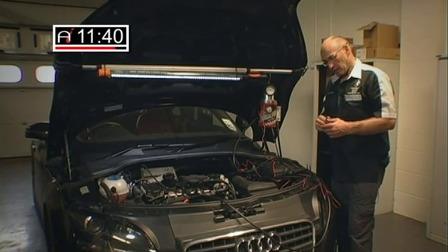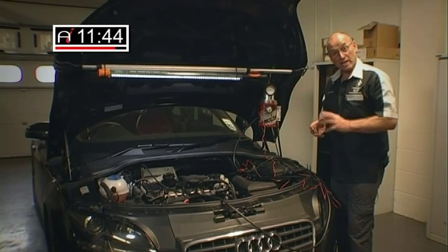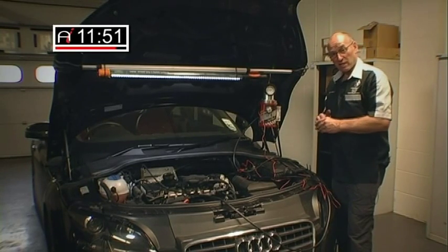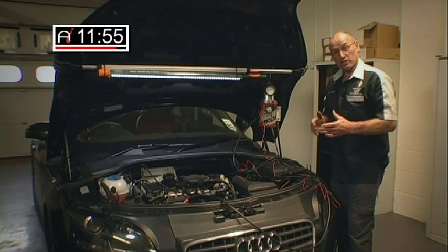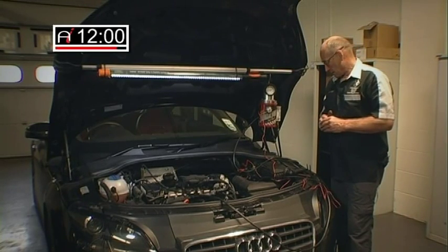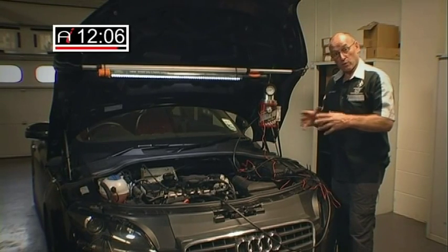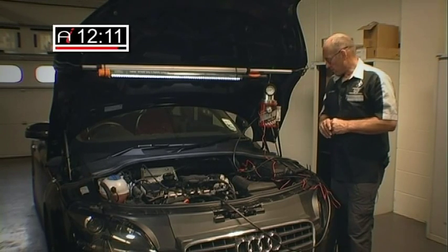This particular vehicle does have a history of problems with the turbo wastegate control valve — the N75 valve. However, this has just come from the workshop; we have already modified that valve because we're aware of that fault and we've resolved it. But that is also an internal leak from the turbo charge recirculation system. So these internal leaks are often the more difficult to find, and it's a matter of working through all of these circuits to determine which is causing the flow on the manometer.